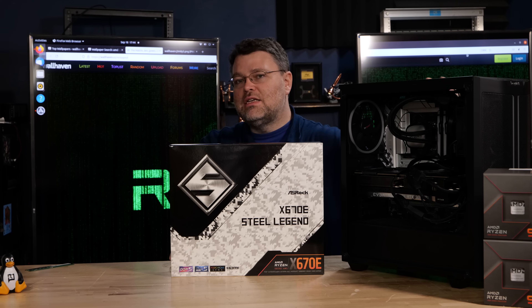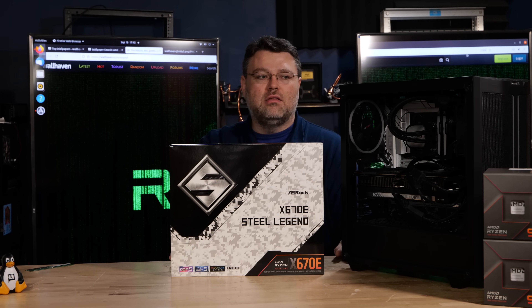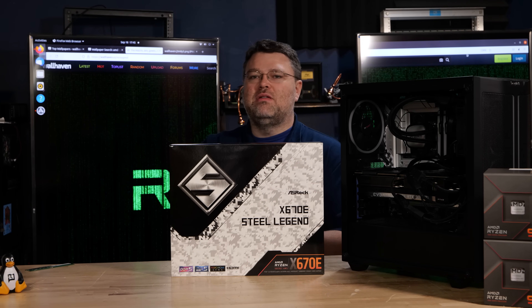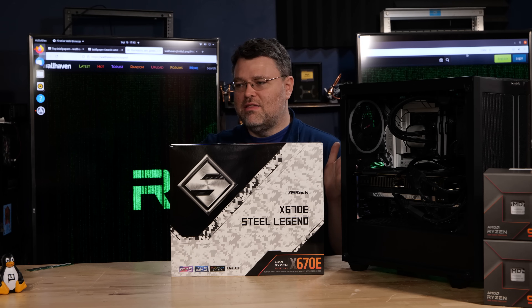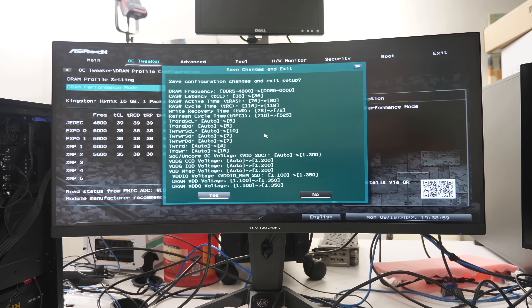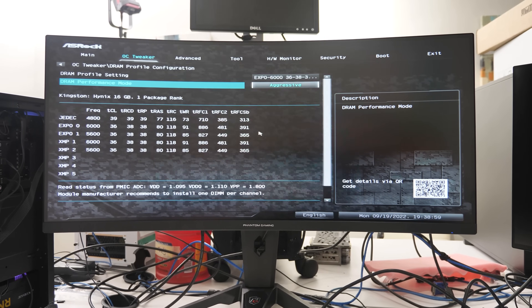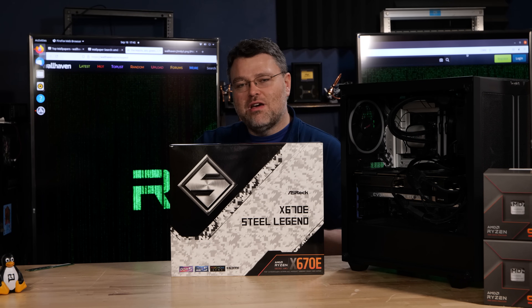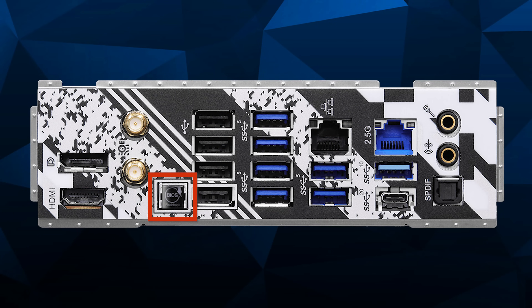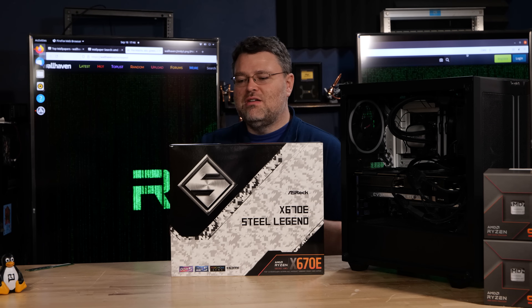As this board does memory training, it does take a little while — 64 gigs of memory training took about 45 seconds. Diagnostic LEDs on the top left edge of the motherboard blink during training, and the system may seem to restart occasionally, which is normal. I went through a couple of different BIOS versions during this review; each had different bugs, but by the time this video came out they had all been fixed — ASRock was responsive to bug reports. If you get this board, plan on launch day BIOS updates. The motherboard has a BIOS flashback button so you can flash it from a USB stick, supporting CPUs that aren't even out yet.